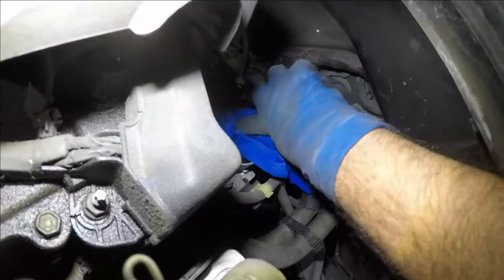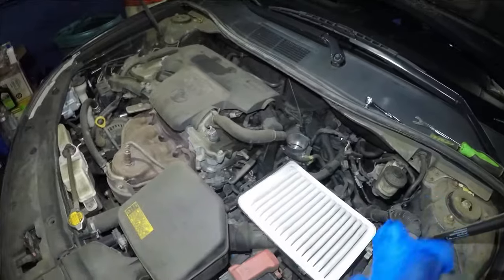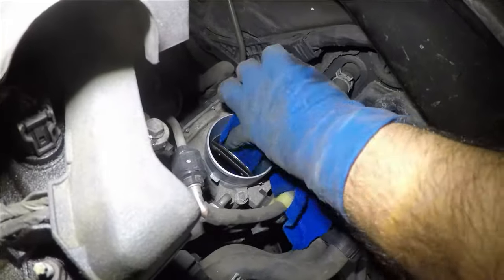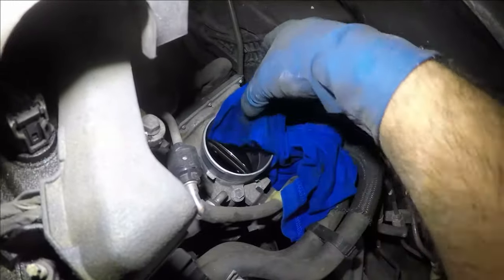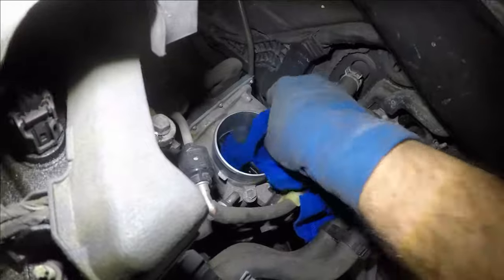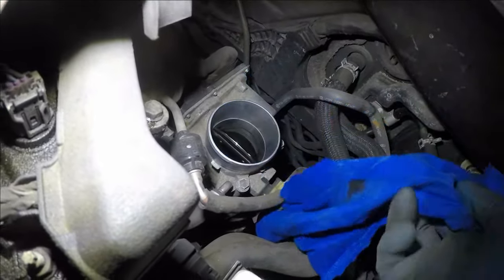I'm gonna give it another shot with the same rag. Let it go. I'm gonna use another side of the rag and soak it up again. My friend told me his car did stall one time even though right now we only had low idle. Go ahead, push it — there you go, it's open. Try not to yank the throttle body — that's the whole function of doing this, you're letting the computer do the job so nothing goes out of whack. Because if you jam a screwdriver in there, you'll mess up the gears on the throttle body.